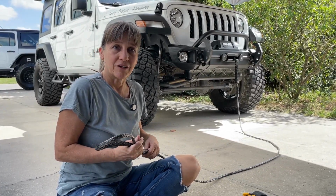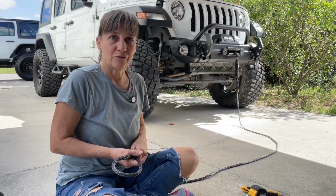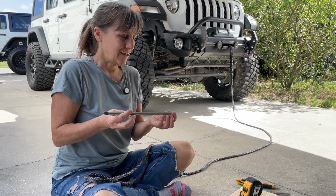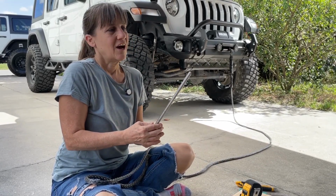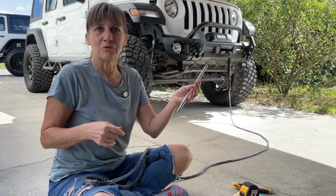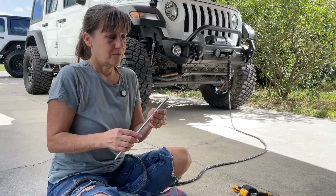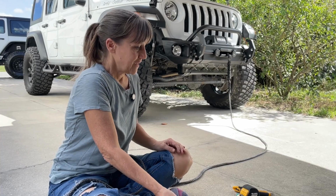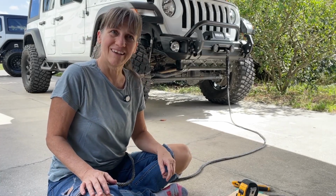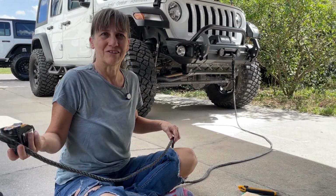There is a very good explanatory video on how to do this on Yankum Rope's website and YouTube channel, and I'll leave a link in the description so you guys can go to it. The tools you're going to need is one of these, which is called a fid. I have seen where people will do it with just any straight instrument that's smooth enough to work through the center of this rope. You'll see what I mean in a moment. But this should make the job a lot easier. Also, something to cut the rope with, and some tape. And then you may want to measure your distances with a tape measure.